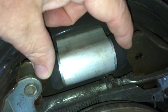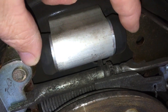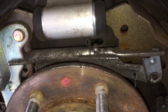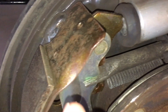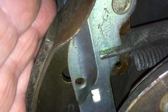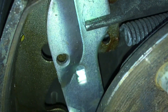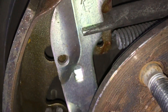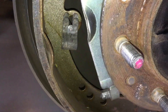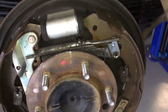So at the top here we've got - it's not the master cylinder, it's the wheel cylinder, right? It is the wheel cylinder. Now these have obviously been replaced at some stage - not by us - but they're almost like new. Just to give people a bit of an idea, the shoe material is probably about two millimeters thick, and the lining is usually about six millimeters thick. They look just like brand new ones being put on there. That's how we roll - we clean things.